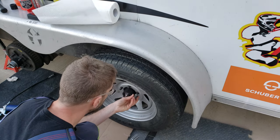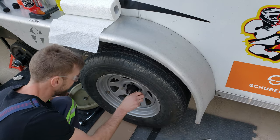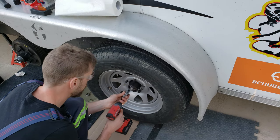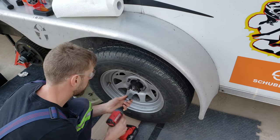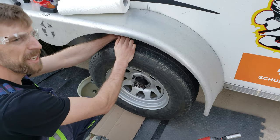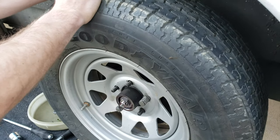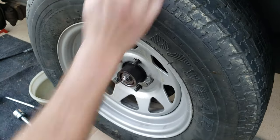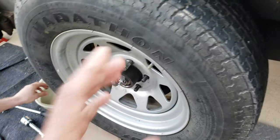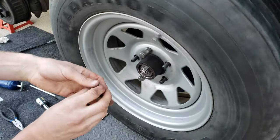The best way to figure out your play is by hand and by throwing a wheel on. I feel just a millimeter of play — it just makes a little tick tick tick tick. And that's perfect. As I spin the wheel I can see if it tightens any more. It's actually touching the brakes — the drum is touching the stuff. So you're not hearing the bearings at all, that's the drum contact.